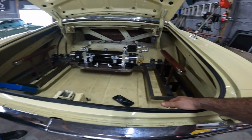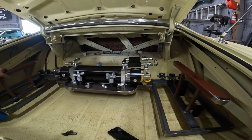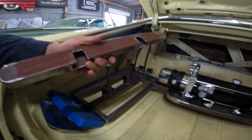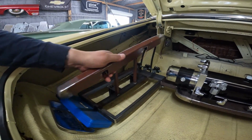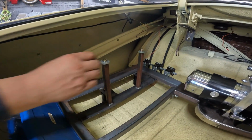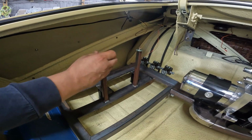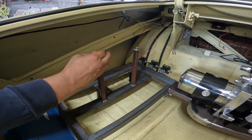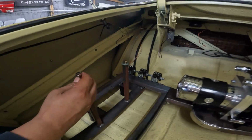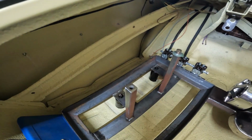And these hold downs, I think that one's still kind of loose, man. Right now it's loose, right? But it'll slide out, so we put some notches in there, and then it'll slide back in. The uprights have little nuts welded in. That's 3/4 inch box tube with a little 3/8 bolt, a 3/8 nut welded inside the box tube. Yeah, right there. And then smooth that out.